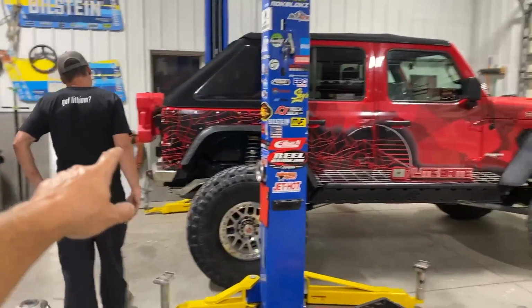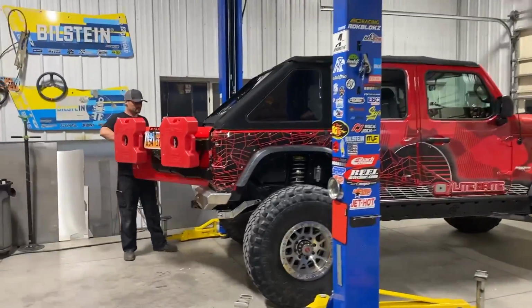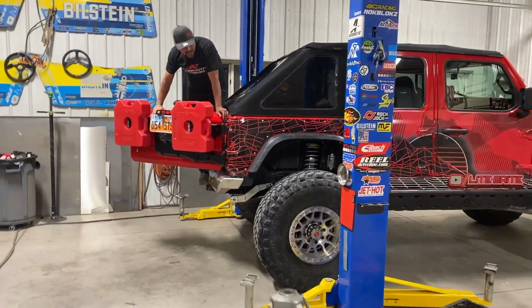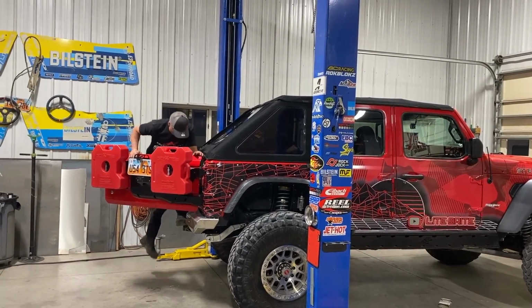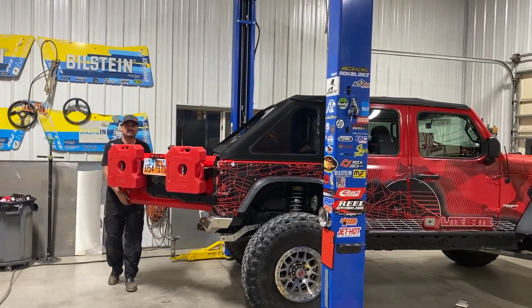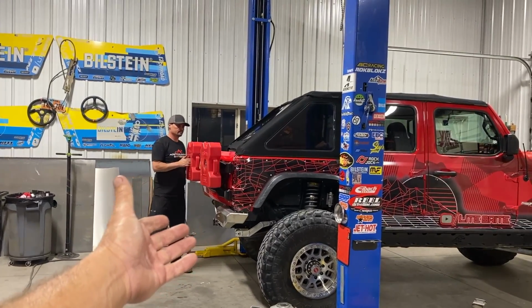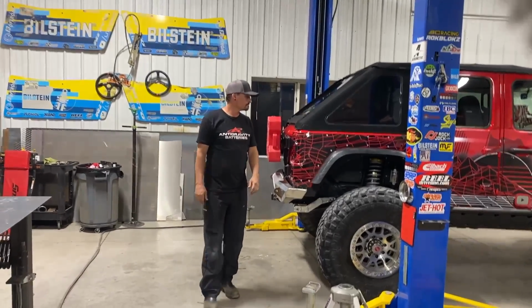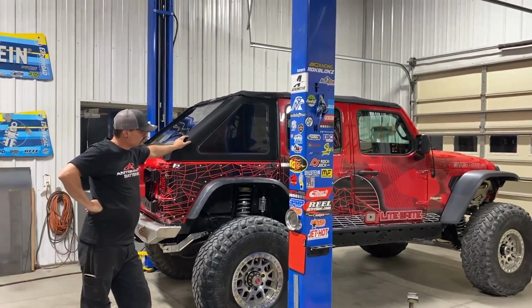That's with only like a quarter tank of fuel left, but if you put a tank of fuel in it, which Chris will demonstrate by using his body weight, now there's the rear. So it drops like over an inch. No, it's close to an inch because it's 200. Am I that fat? Are you telling me I'm fat? 200 pounds. I bet you, because they're 200 pound springs, so it'll drop 1 inch with 200 pounds, and you got to be close to 200 pounds. So that looks a little more subtle with a full tank of gas or with tools or people back there.